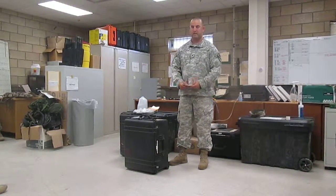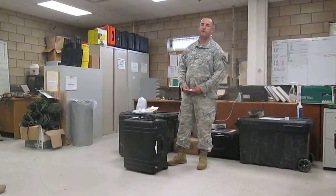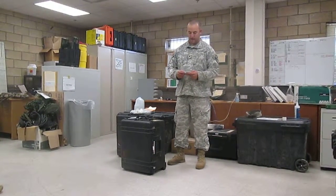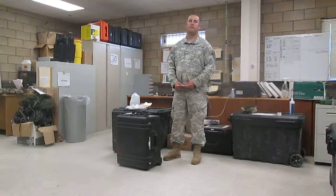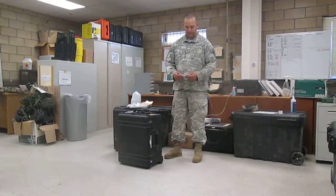If your starter is still not cranking over and you still don't have voltage at the starter, at this point it can be determined that you have a serious electrical problem that needs to be taken to a professional. So you've done everything that you could. And at this point, if you have gotten the car started, you may have just fixed a symptom. You might not have fixed the cause of the issue. That brings me to my final point.